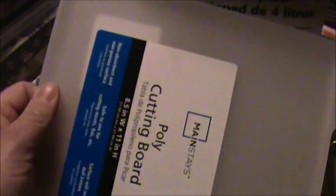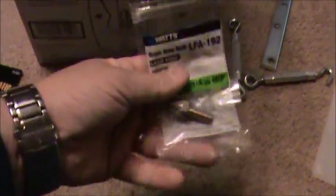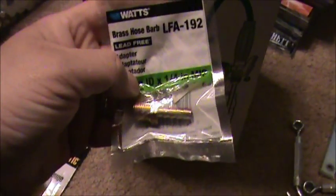We need a top plate for the master cylinder to put over it instead of a cap. We're going to take this cutting board and cut a section about the size of the top of a dual cylinder, either Ford or GM master cylinder. We're going to drill a hole through it on one side, use some inner tube to make a gasket, and put this barbed fitting in there — that way you've got an outlet for the fluid.